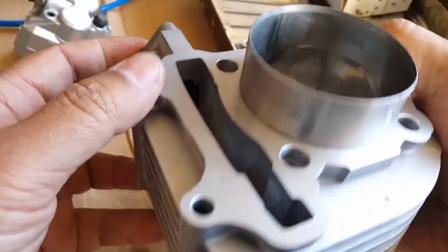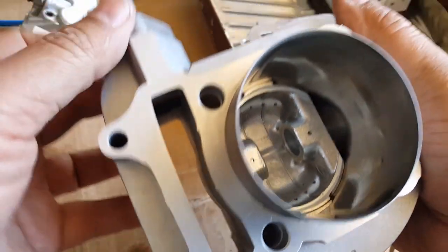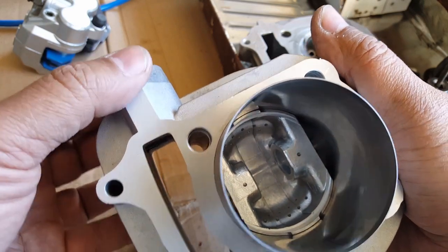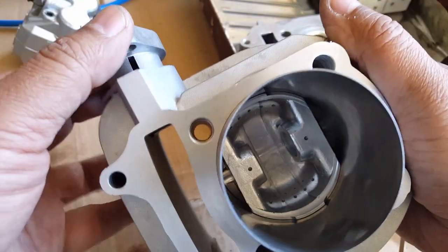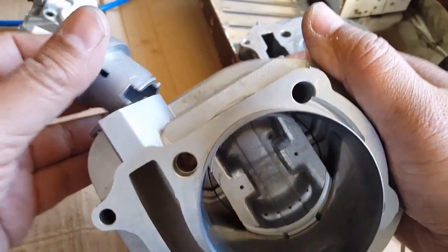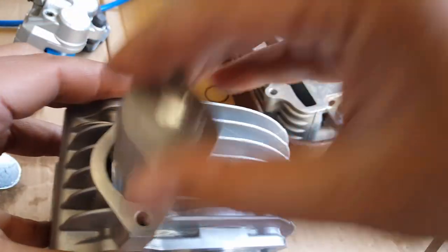So that's it. That's what I'm planning to do. It might change, who knows. Like I said again, one gasket is actually sufficient, and it still makes the cam chain feel loose, not very tight. Then I'm probably going to have to replace this with another cam chain tensioner that's fully functional. So we'll see. But everything here is very clean.